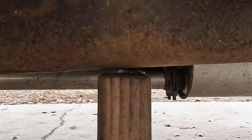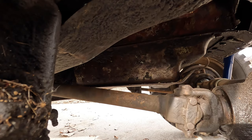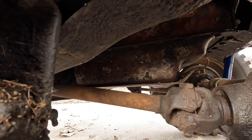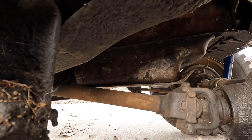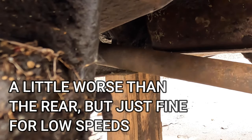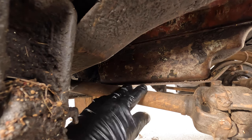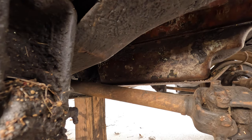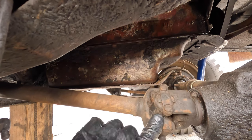Let's move on to the front. Now I've got one of the front wheels jacked up. We're going to do the same thing — I'm just spinning the right front wheel with my hand. Keep your eyes right there, we're going to do our redneck straightness test here. You can obviously see how much smaller the front drive shaft is compared to the rear. So in this vehicle when you're in four wheel drive, the rear wheel drive is still doing most of the work. Just like the back, it appears that our pinion seals in here are in decent condition because they don't seem to be leaking.